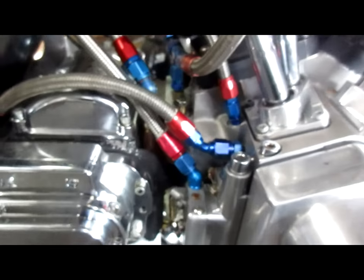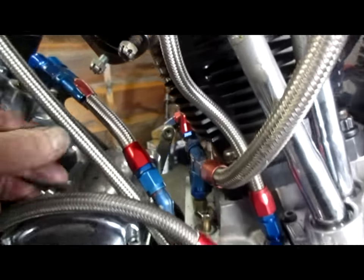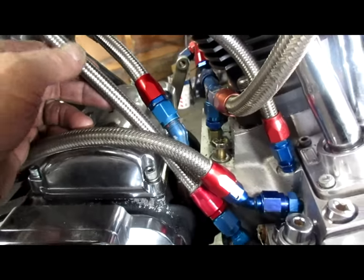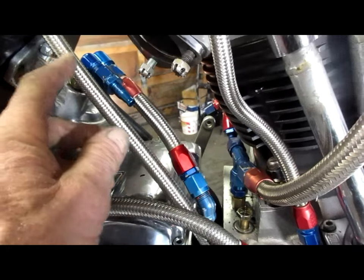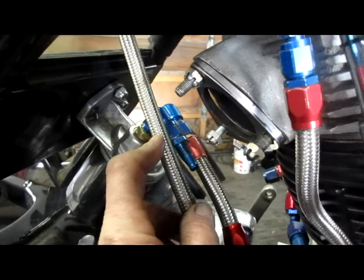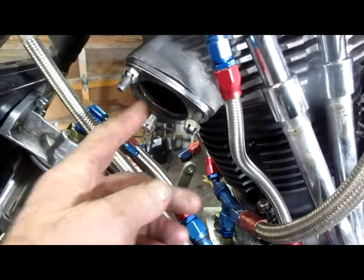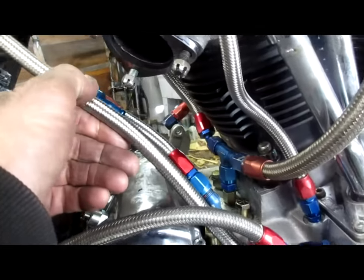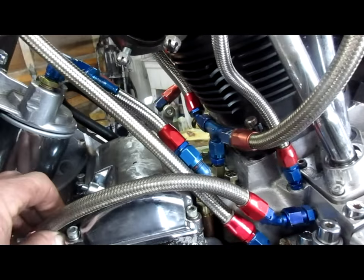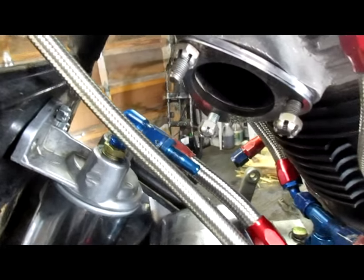The Earl's are a little bit more difficult to put on. I'll show you how I do it. Looking at the motor, you can see I've put on dozens of fittings already. I've got one left that needs to be hooked up. I've cut my hose and put the fitting on so the hose reaches up to where it's going. You want to plan this out so your lines clear stuff like exhaust pipes, and run the lines the best shortest distance you can.